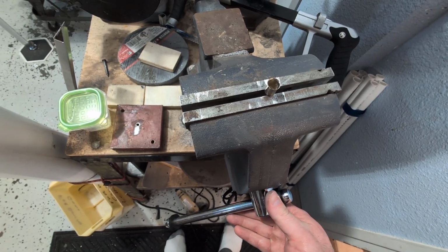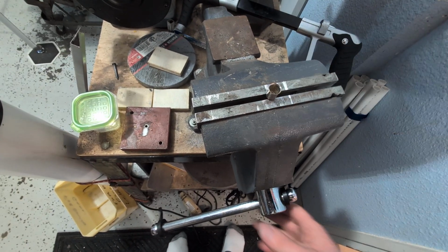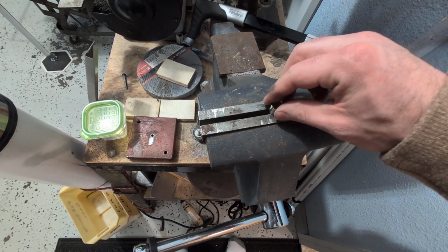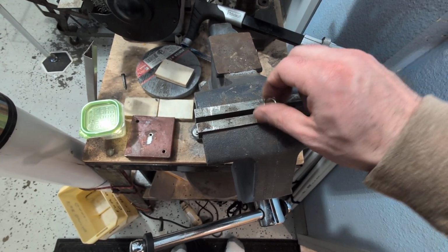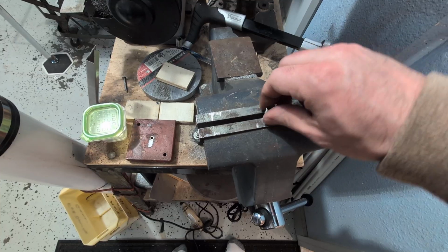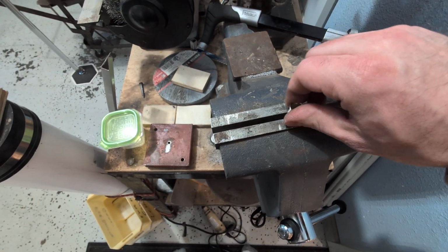Then I just went until it got a little bit snug. So now it's bottomed out under its own weight and that flared edge is in there. And if you get it snug, you can keep spinning it until it gets tight. And then once it gets tight, we're going to use the parallel jaws of the vise kind of as a metal roller, with just underhand pressure only. It gets a little bit tough, but then it gets easy, meaning that you rolled the edge a little more, and then you're going to keep going and going until it comes back to parallel and it can fit through the hole in the new plastic. You can also look down the vise and see daylight so that you can tell when you're getting close to getting it done.